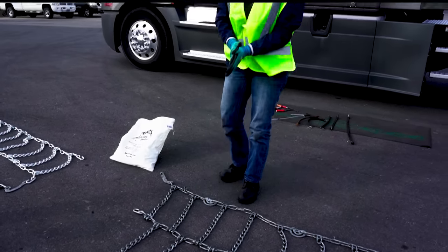Now I want to pull this chain over the top of that tire and I definitely do not want to drop it down. So I'm going to come in here with what space I have to work with and pull it over the top. The next thing that we're going to do is make sure that the chain is even side to side. You can do this by feel - just reach down there and feel how far down you are. If you need to adjust side to side, you're just going to feel for it. You've got to do the same thing to the inside - just reach in and see where that rail is. Everything needs to be pretty much even. And once we've confirmed that we are even in both directions, we'll move on to connecting the rails.